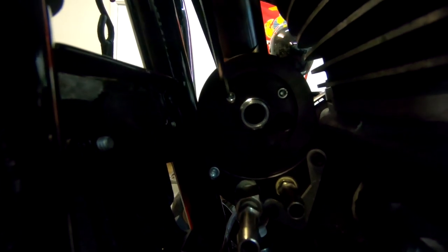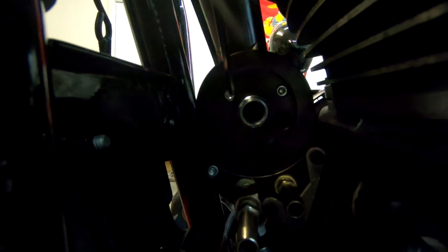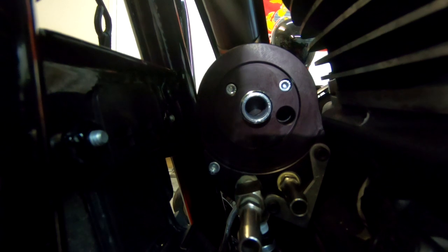To install the front half of the adapter to the back half of the adapter, you wanna tighten down all five of the Allen key bolts evenly. And then once it's against the backside, what you wanna do is change to a star pattern or crisscross. So you would start here, you skip a bolt, go to the next one, skip a bolt, go to the next one, skip a bolt, go to the next one, and you keep doing that until it's all the way tightened down. And that's how you do that.